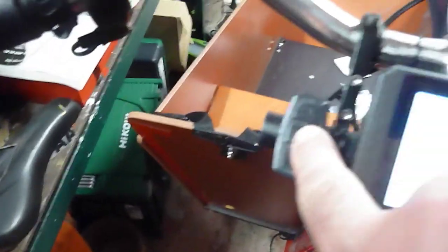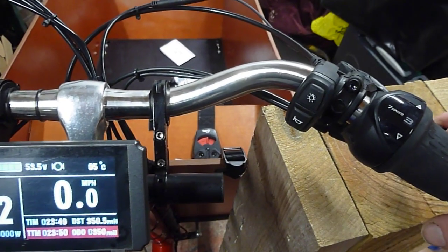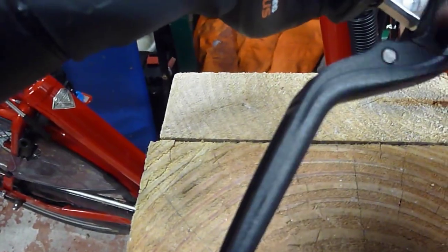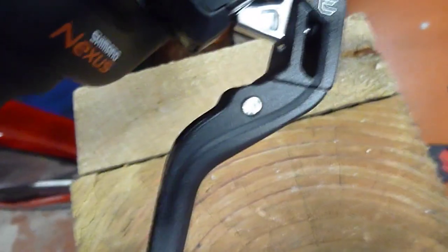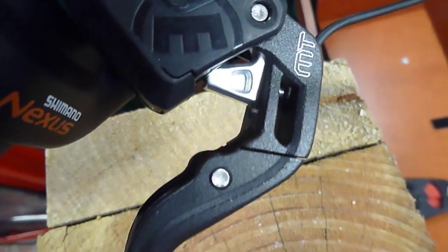Just got to check it works - turn it on. Can you see it there? It lights up the brake symbol, and it's quite a sensitive switch. It's got the double pivot - that's the pivot where the pin was, so it operates the hydraulic part of it, and then there's a second pivot here, so the switch is between these two bits - the electric switch. There's a tiny tiny bit of movement there - it moves a fraction, so the brake cutout comes on before the brake is actually applied.